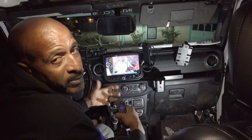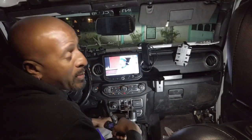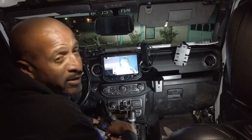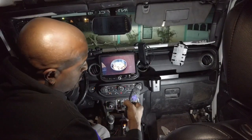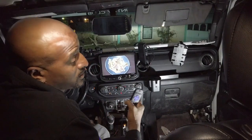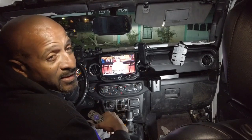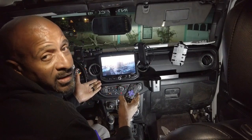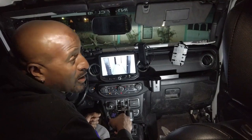So, you know, that's just some information I want to throw out to some of y'all, just in case you didn't know. I know a lot of y'all know about the Roku, the Fire Stick, and all of that, but there might be a few that didn't know. So if you take your Roku Ultra, wire it into a switched 12-volt output source, put it into the HDMI on your Stinger or any entertainment system that's similar to the Stinger, and guess what? You're good to go. That's just a little tip. Something for the ones of y'all who don't know.